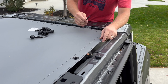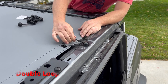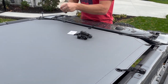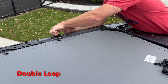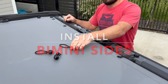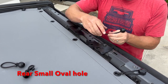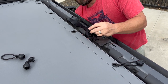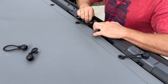Moving up toward the front of the vehicle, take a four-inch bungee and come up around — give this one a double loop. On the passenger side, up through the bottom with a four-inch bungee, give it a nice double loop. Moving toward the front of the Bronco, take our four-inch bungee in the oval hole toward the rear of the Bronco, push that bungee through, wrap it from the bottom, go through the grommet hole and back around.